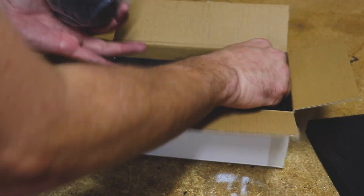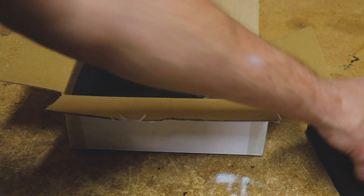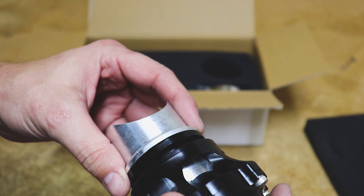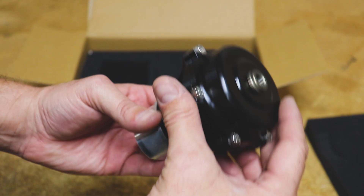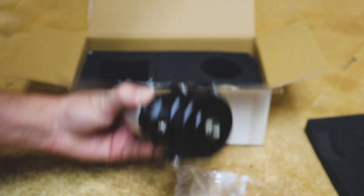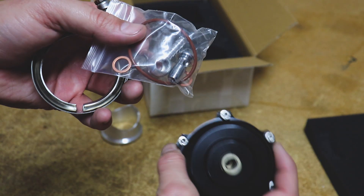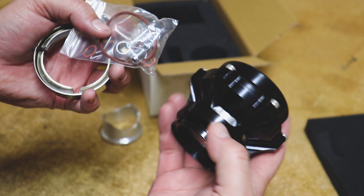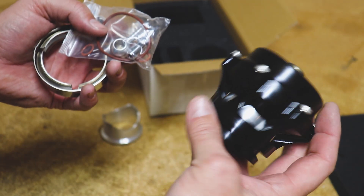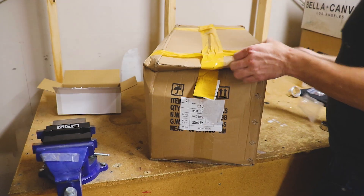More goodies for the car — packed very nicely. It's a 58-millimeter blow-off valve. Here's the bung for it to go onto the intercooler piping. What I liked about this was the fact that it's V-band. The HKS knock-off that I have — those things are a pain to get on and off, and I'm realizing I'm just not a fan of the whistle. So I want to try something else. Here's our V-band clamp, an O-ring, and plumbing for the vacuum and boost signal to the wastegate to keep this thing shut. This is good for up to 35 pounds; I imagine we'll be running in the low 20s PSI with our turbo and our compression.